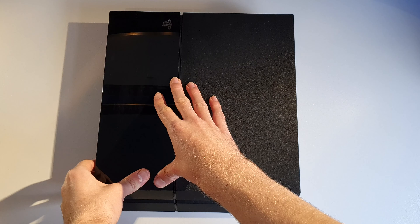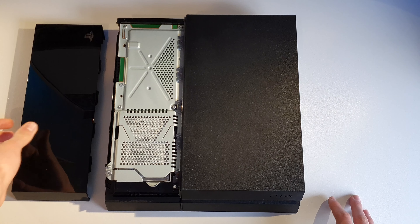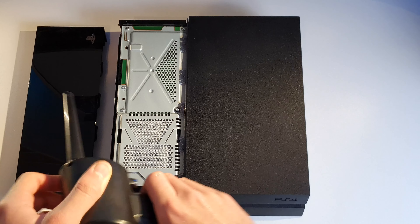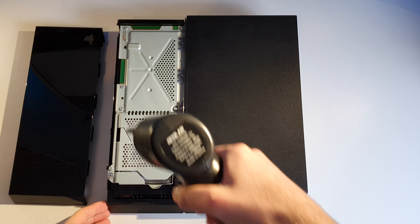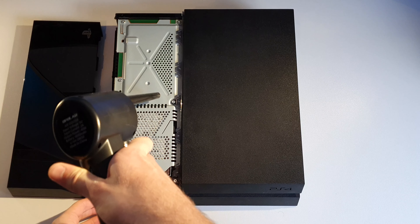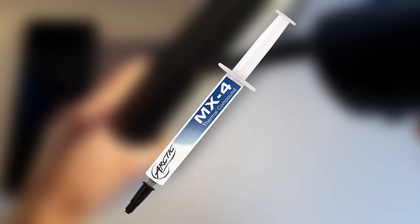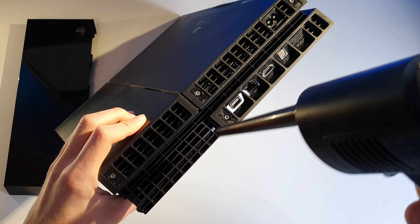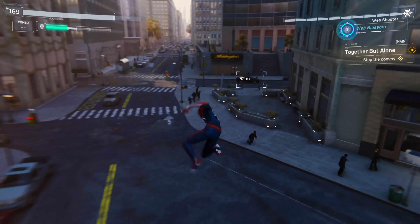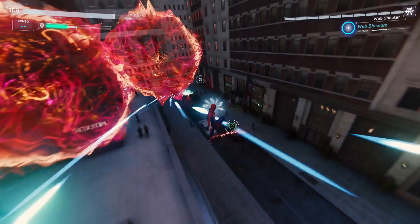For the original PS4, slide off the glossy panel and then clean what you can access such as the vents on the system. Unfortunately, you cannot get to the fan without voiding the warranty here, but you can try to suck out any dust from the rear of the PS4. To go a step further and really quieten down your console, you should replace the thermal paste and the thermal pads, but we don't have time to do that in this video. I will link the best guides to doing this for all three systems in the description, as well as the best thermal paste for the PS4, along with all the other equipment that you might need.